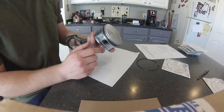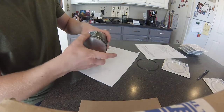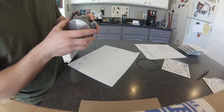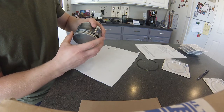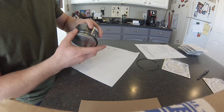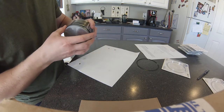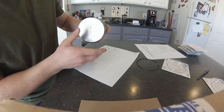One step you should do as well — if you're reusing your piston, take the ring and slide it around. It should slide very easily. I'm reusing my pistons and they're within spec, but I did notice there was just a tiny bit of a metal burr. As the piston ring was sliding, it would stop it — it wouldn't allow the ring to move around, and that's important for it to seat correctly. I just took a very small file and filed off that burr to make sure it can move around freely.